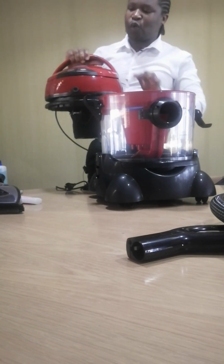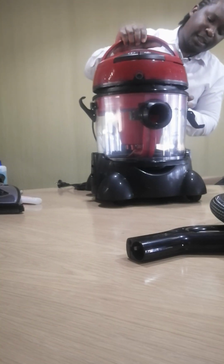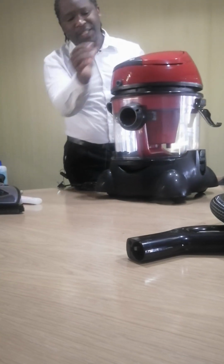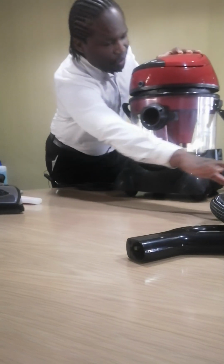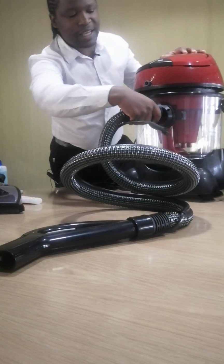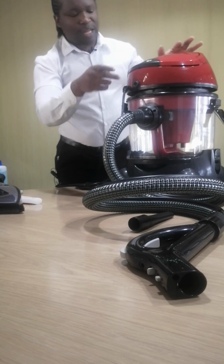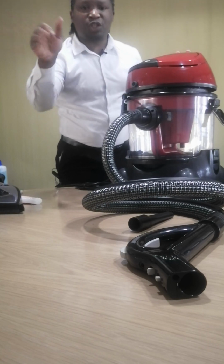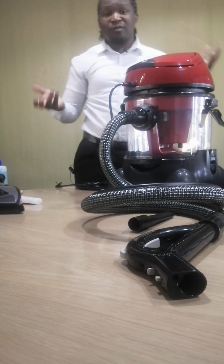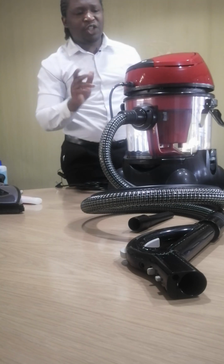And when you put the head as well, the buttons will be going in line with the clear bucket intake. Why? Because below the buttons, there's another solution pipe that you're going to be needing from this. Once you attach this here, you then need to attach the solution pipe that is now going to be taking the water out of the machine into your carpet. So you now attach it here, and you just need to align it, and you go clockwise, and voila, that's your machine.